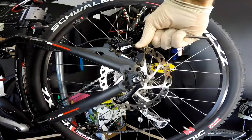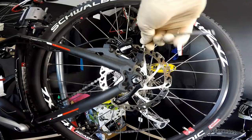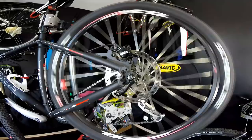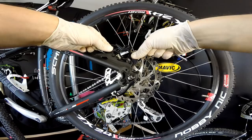I'm braking and will keep the brake with my left hand, and now I'm fastening those bolts. While braking, the braking pads are squeezing against the disc rotor and truing the caliper against the rotor. This tip works for most models — sometimes perfectly, sometimes not. I'm not braking anymore — let's see what happens. It's much better but not perfect.